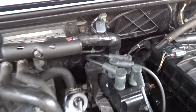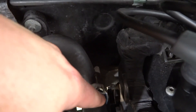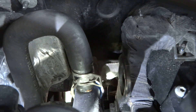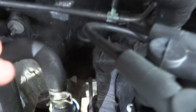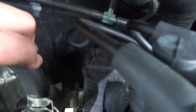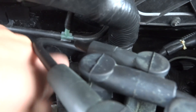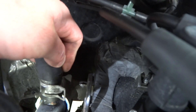On mine I noticed on the elbow right here on the back there was a little cut in it. As you can see underneath the bottom right here you can see where it's actually got a little bit of antifreeze — a little bit of greenish with the brown kind of rusting out the pipe a little. But on further inspection right here on the top, the hose is splitting right there. See the hose splitting? So that wasn't good at all — that's where one of my leaks is, and it's pretty much all the way through.